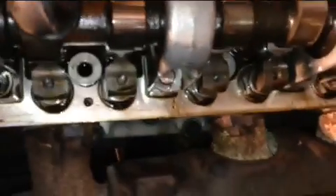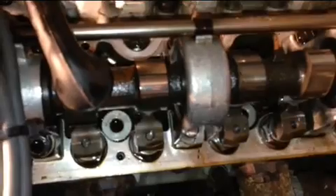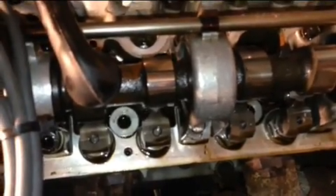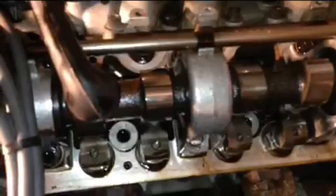There are only four spark plugs on each bank, which makes it eight total. Thanks to God, because Mercedes is known for putting two spark plugs per cylinder — on the V8 that makes it 16 spark plugs, times about five dollars each for Bosch spark plugs. On a V12 it's 24 spark plugs, so heads up when you do motor work on these engines.